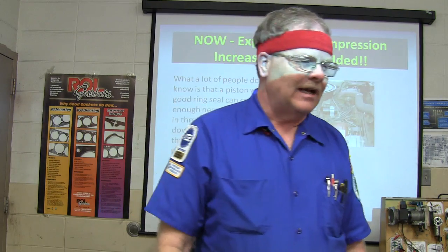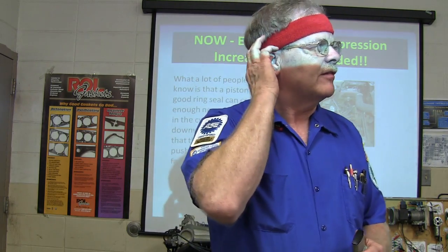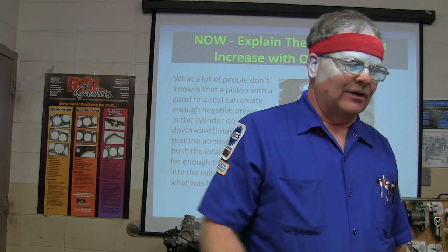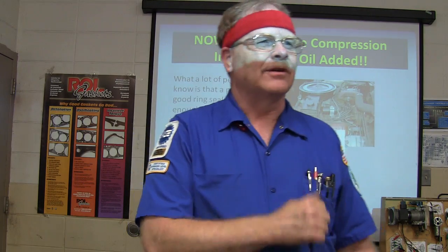And I got my little 3/8 impact wrench, and I pulled all that stuff apart. And I got it off, and I put it on the bench, and I took it apart, and I put another valve in there, and I lapped it in with some compound and slammed it all back together and torqued it down, filled up water, and fired it up before dinner. Had it done in 2 hours.